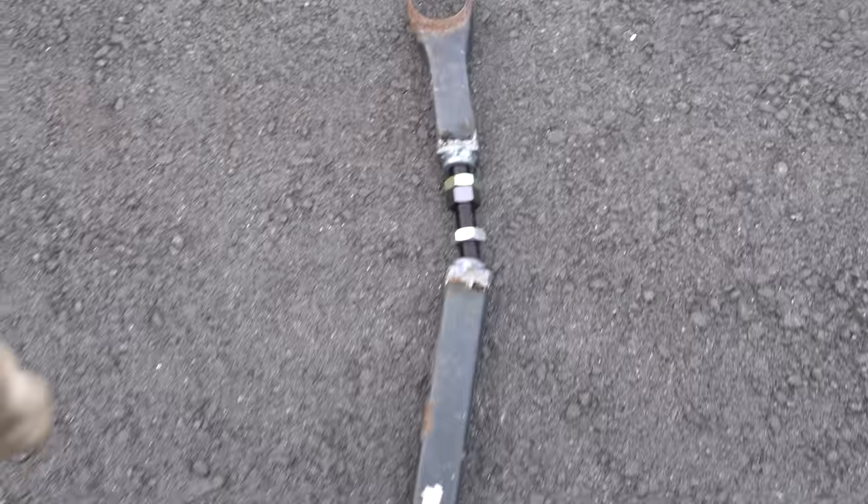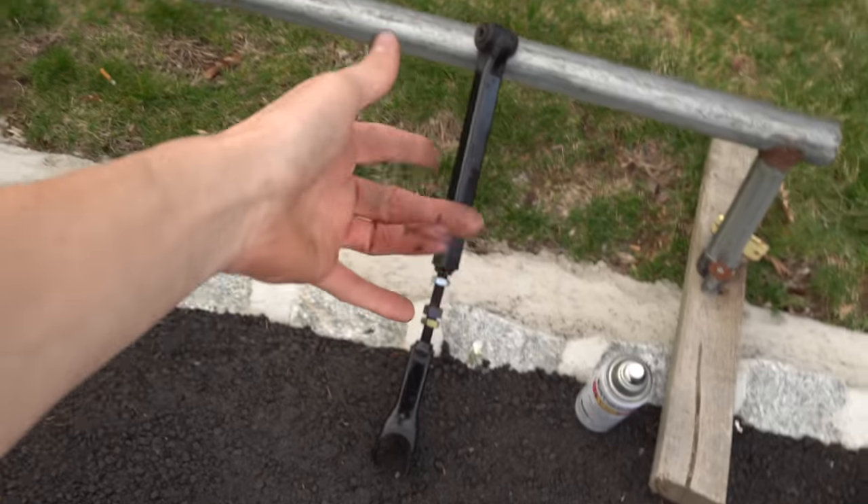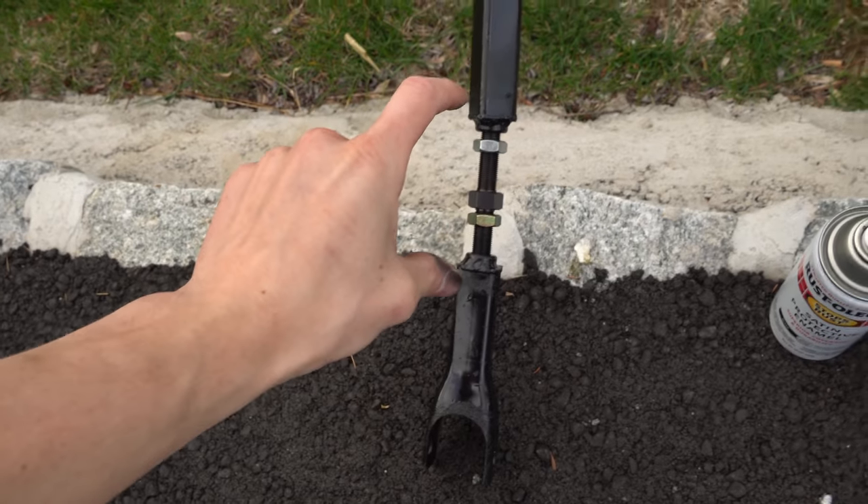I just finished welding this side - this bung is in here nicely. I'm going to thread these two together and show you guys what it looks like all in one piece. I put those two pieces together, got Rust-Oleum paint on there, and to speed up the process I took my torch to it. Look how good these two look together - we'll be able to thread this all the way in so they're butted together or we'll get full extension. We can go stock camber or negative 30, whatever your heart desires. Let's throw it on the car.